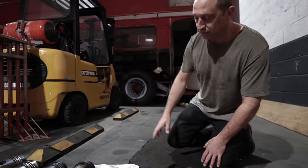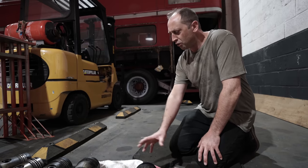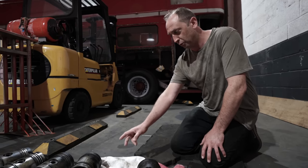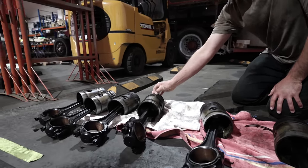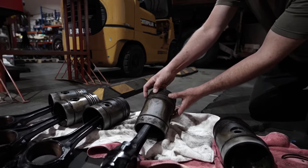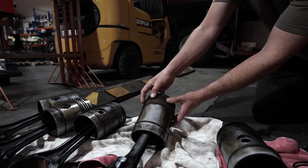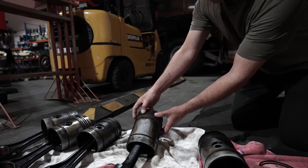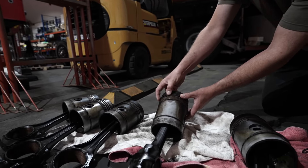Okay, so we've now got the engine fully dismantled, and considering how well it ran, there are a number of issues that we've highlighted. There's excessive amount of play in the top rings, that's quite serious. Not sure how well you can see that on camera, but there's quite a distinct amount of play on those top rings. So the pistons are well worn, so that's one issue that we've got, which we think may well be from its life, possibly as a fire engine, in its time as a fire engine, that's a bit of a mouthful, or possibly I believe it was a generator at one point after that.